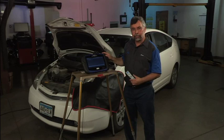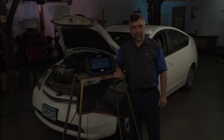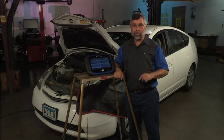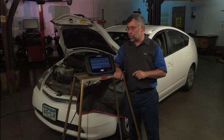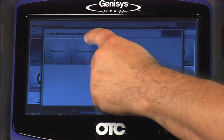The test is now complete. We're going to move on to the third scenario: zero point calibration for the Toyota. This is available in two locations — on the ABS controller and also under maintenance tests. The reason for doing zero point calibration is if you replace your yaw rate sensor or your ABS module. I'm going to show you how to do it under maintenance tests. I'll tap on maintenance tests, then tap on steering service.